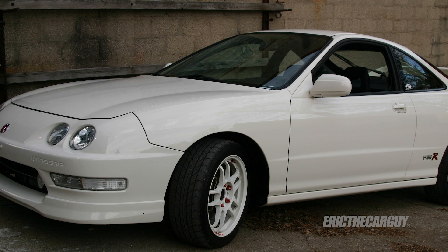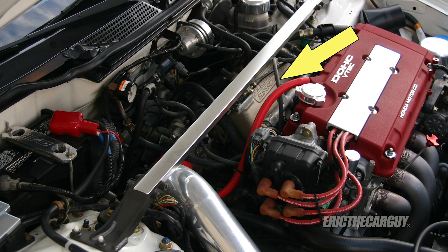My strategy is actually modeled after a vehicle I was a caretaker of years ago — a 1998 Integra Type R that had a Jackson Racing supercharger on it. He didn't run a lot of boost — I think eight PSI max. I don't really feel that you have to run a lot of boost. All I'm trying to do is give myself a little more bottom-end torque. This engine makes great power at 5,000 RPM and above, but below that it's a little weak — so if I'm trying to get from cone to cone on an autocross course, I'd like a bit more bottom-end torque. And my thought is if I don't go with high boost, even without a heat exchanger, I should be okay. I'm also going with this over a turbocharger because exhaust manifolds on turbo setups usually necessitate removing the air conditioning, and I want to keep my AC.